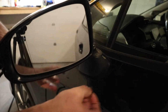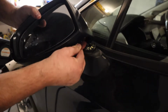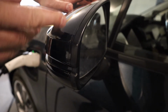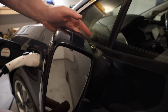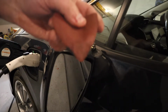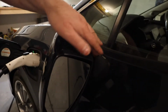Just enough to get that bite, and then I don't want to pull because the wires are in there, but I have roughed up here a little bit already. I'll do this a bit more because when I put it all together, it will actually sit there. That's where it's supposed to be. But yeah, I want to make sure that I've roughed it up enough that when I put the epoxy there and on this side, I can hold it because that's where it needs to be. So again, 80, 120, probably 200 would work too. It's nice enough. You can see that it's got a pretty rough surface there. You can see that it's lightened up the plastic there.